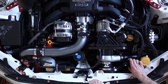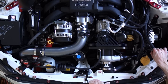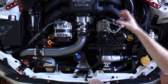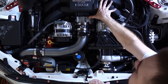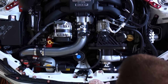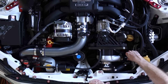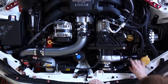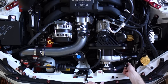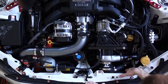When you lift off the throttle, suddenly you've got a much greater pressure on the intake side of the valve than on the vacuum side. The reason for that pressure difference is because the butterfly valve is closed but the cylinders are still sucking in air. So you've got a vacuum on the intake manifold side of the butterfly valve which is creating a vacuum in the top of the blow-off valve as well. When you've got that vacuum coupled with the additional pressure inside the charge side of the system, that pushes the valve up and allows the excess pressure to escape. So you've got a spring-loaded and vacuum-loaded valve which opens when the pressure is greater on one side and closes when the pressure is greater on the other side.